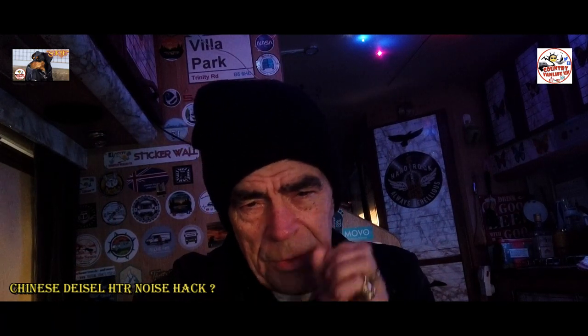Anyway, there's lots of people that knock them for the clicking noise of the pump, click, click, click, click. Especially in van builds, you see the YouTubers, and you always hear that clicking noise in the background, and it's bloody annoying, I can tell you. I had it on mine when I first started it, but I made an adjustment to the actual diesel pump. It's the diesel pump doing that clicking noise. It's a solenoid stepping in and out, pumping the fuel through the line that's making the noise.